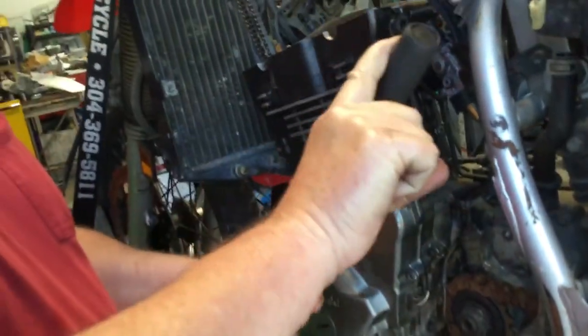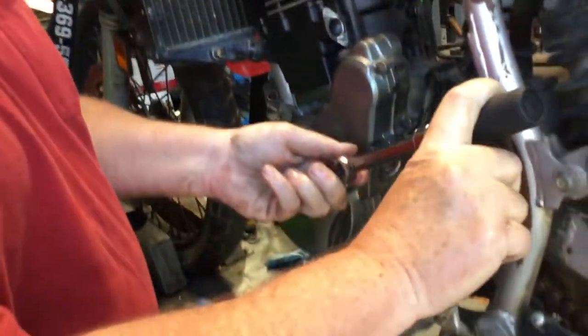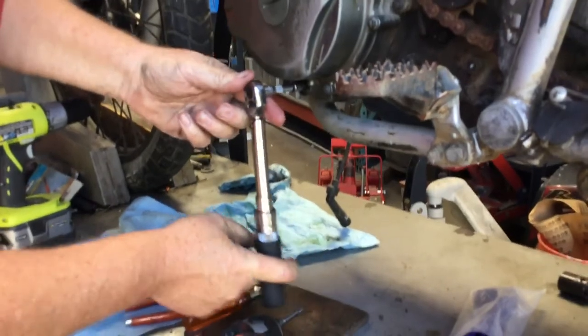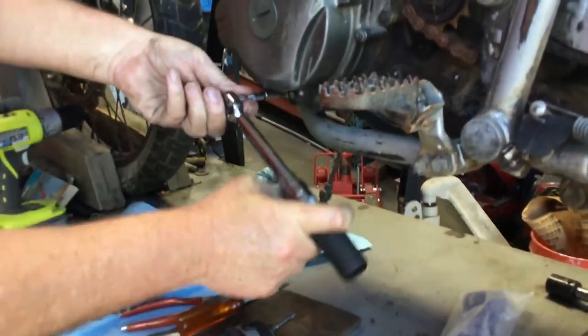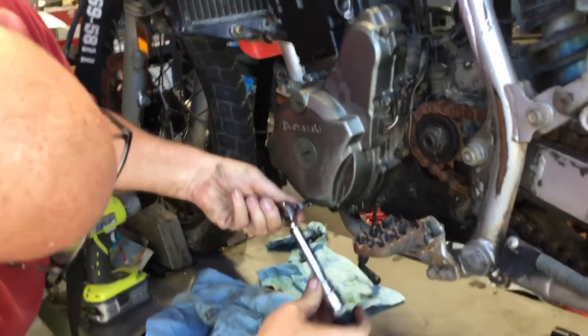And this is how much it takes. You can do it with one finger, okay? Never used a torque wrench before, practice on stuff that doesn't matter. So you can see how easy that is. So be sure to get your doohickey bolt the same amount. The thing should not be running with that doohickey bolt loose. It's wrong. It'll break the spring right away and screw up a bunch of other stuff.